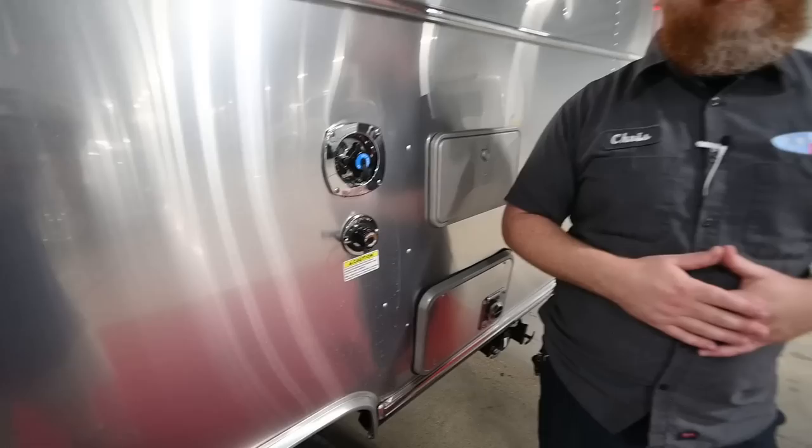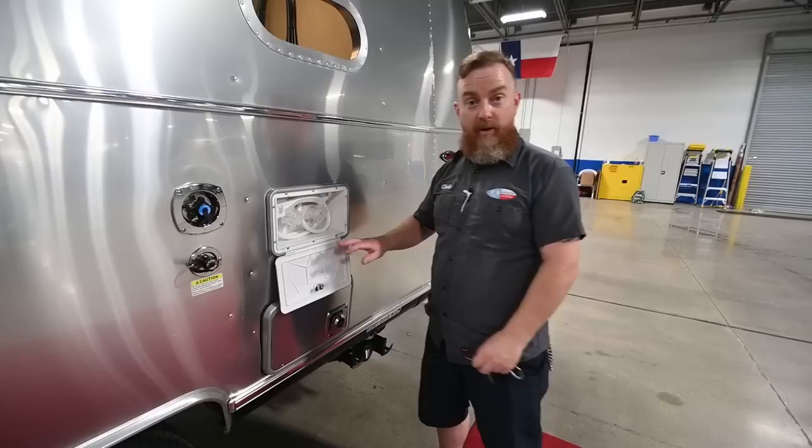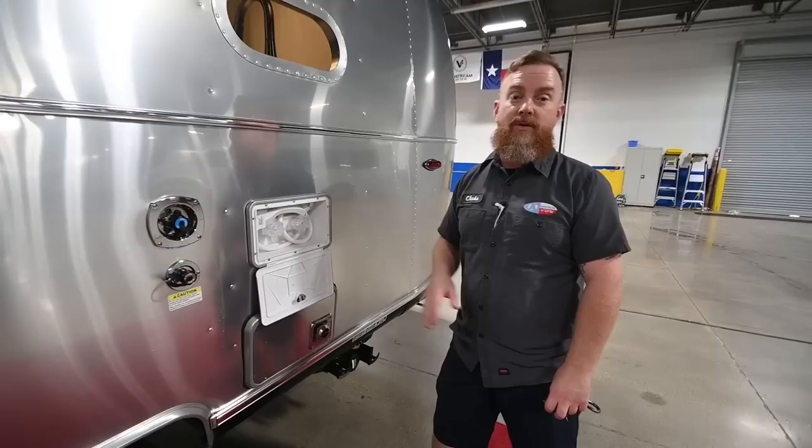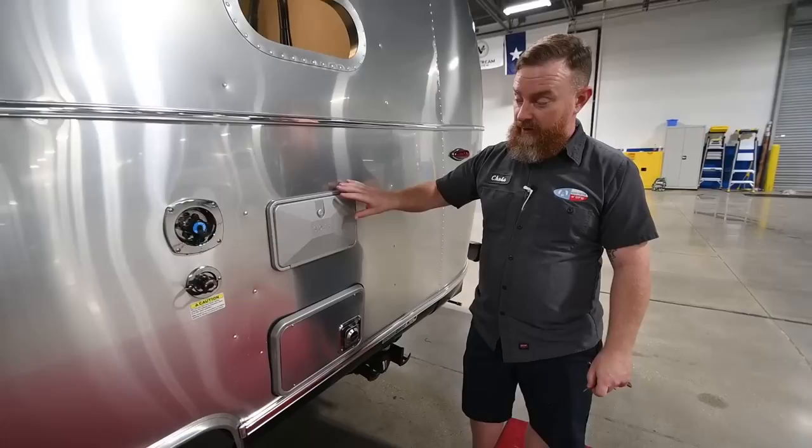Below that, you have the waste clean-out valve — when you attach your water hose here, it puts water directly into the black waste tank to help flush it out. Next, we have your outside shower. If you're boondocking and using this with the fresh tank, you'll need to turn on the onboard water pump. City water will pressurize every faucet including this one. This trailer also has an on-demand water heater — the default for the control panel is on, and as long as one of your propane bottles is open, all you have to do is open the hot water valve and within 10 or 15 seconds you'll have hot water.